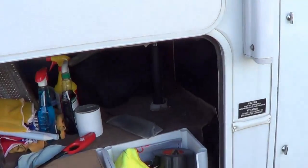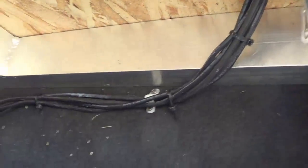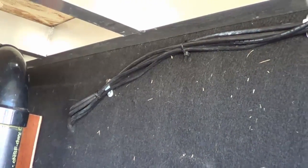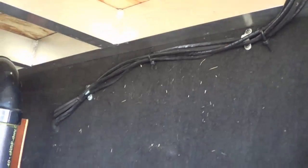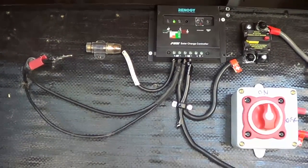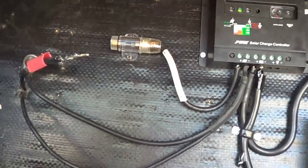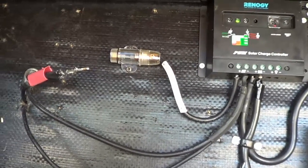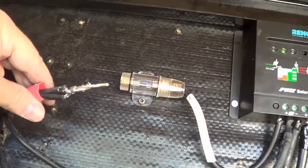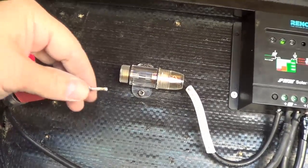In the front basement storage you can see where the wires come down — same as last time. I zap-strapped them to the existing pair of wires from the first two panels and drilled one more hole to get the wires into the front storage compartment where the batteries are. Down in the front storage compartment with my batteries, inverter, and charge controller, I decided to solder the wires together rather than use a junction box — paralleling the second run of wires together. That makes a really good connection without worrying about a junction box with corroding terminals.